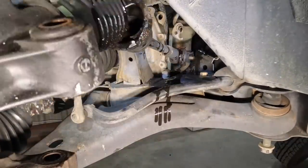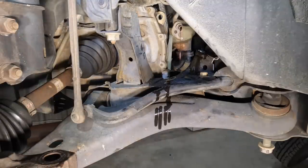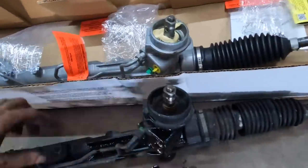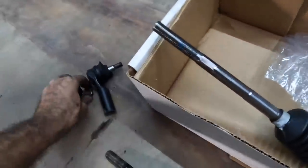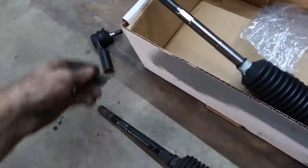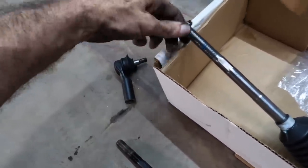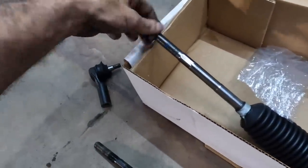Back on the driver's side wheel well — let's wiggle this thing out. I've generated enough space. It's moving — a little hung up on the other side, probably the tie rod. Give it a couple good yanks and she'll come out. There it is — there's our full view of our carnage. Old unit and new unit lined up — mounting points are the same, length is the same. I had to disassemble the old ones just to get the jam nuts, since the new tie rods and new rack didn't come with jam nuts.